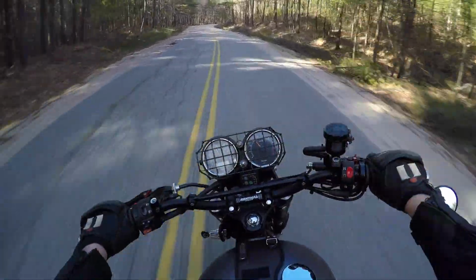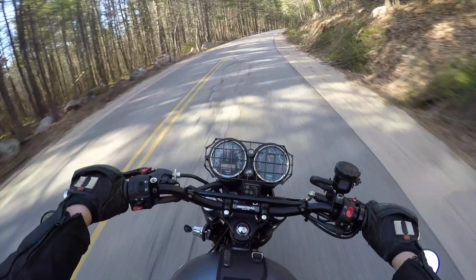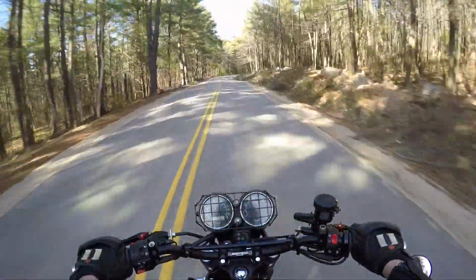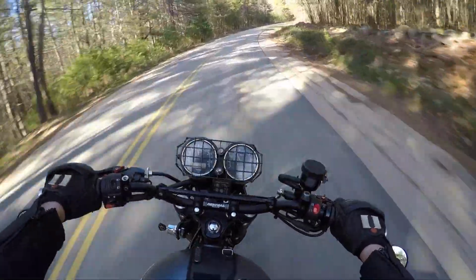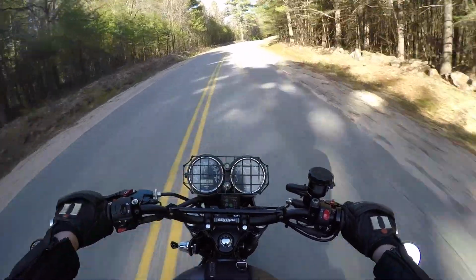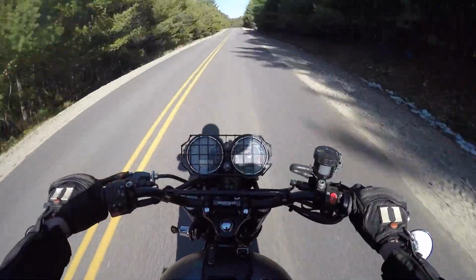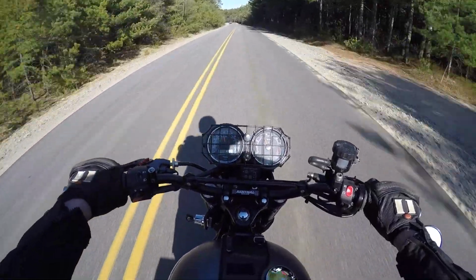It's a smaller bike, so two-up passenger riding is a little tricky. The bike also vibrates a little bit, but I mean, it's nothing that isn't manageable, especially for the style bike. I just wish factory it came with a little bit more power, but again, with Tune ECU downloaded and buying a twin tune, maybe changing the bell mouth, some aftermarket cans on it, I mean, you're talking about a pretty solid contender for the power category.